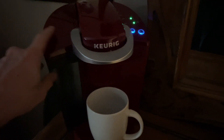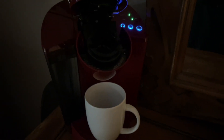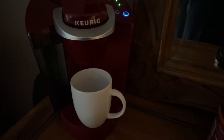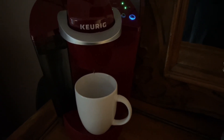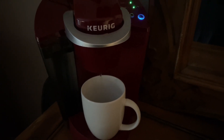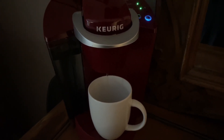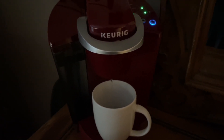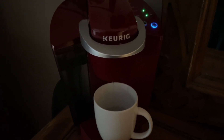After about an hour, rinse the reservoir out and put clean water in it, then start running cups of clean water until the vinegar smell is gone — that gets it out of the internals. The last thing we want is a cup of morning coffee that tastes like vinegar, as that could start the morning off sideways. Hope that helps and alleviates any concern you might have. I was coming at it thinking I'd get rid of mine, but nope — just going to live to see another day. Have a good day.